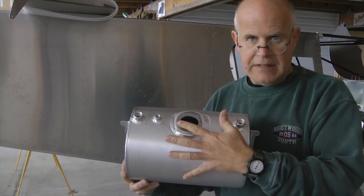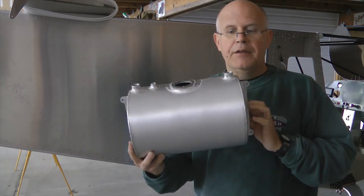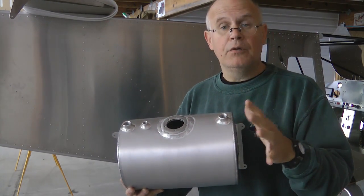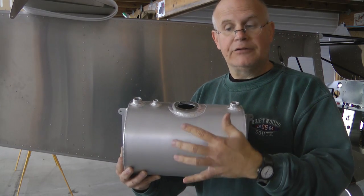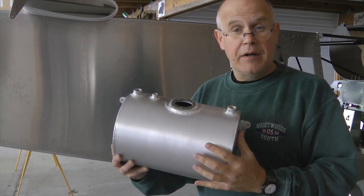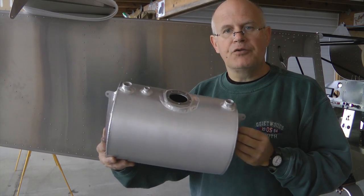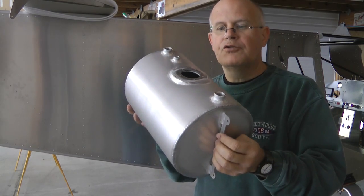It is important to vent the tank independent of the fuel tanks also. The idea here is that this will collect fuel from both tanks before supplying it to the engine. That way, I can monitor my last drop of fuel from my main tanks, because they must pass through here first. I will have a sender with a gauge, and I will know the minute this starts becoming less than completely full. If it does become less than completely full, I have about 20 minutes left with the two gallons provided to the engine. So it is a way to use up all of the fuel in your tank and get a warning when you know you have a certain amount of fuel left.